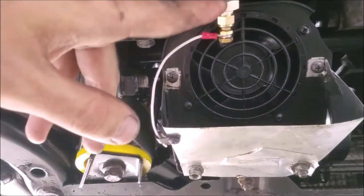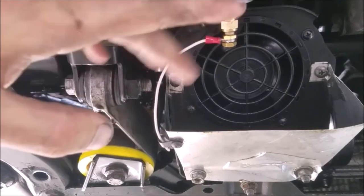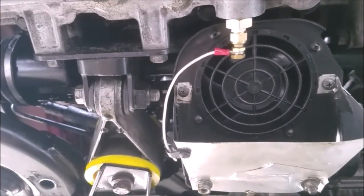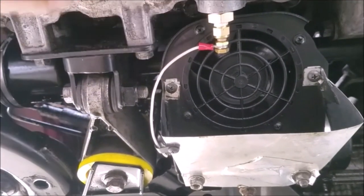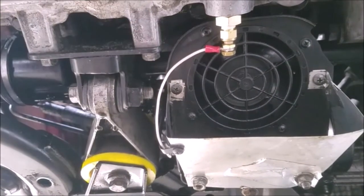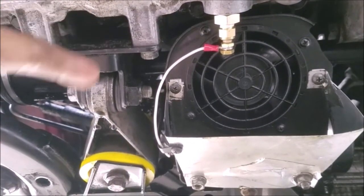We can see where the drain plug would plug in, but we've got our adapter and temperature sensor there. The wire runs off to the side with plenty of ground clearance, tucked in over by the fan and running back to where the original wire was. As I change my oil I'll just swap out the crush washer — no sealant on the threads, just a crush washer like a normal drain plug. It looks really nice, very quality, and I think it's going to work just perfect with everything up and out of the way.